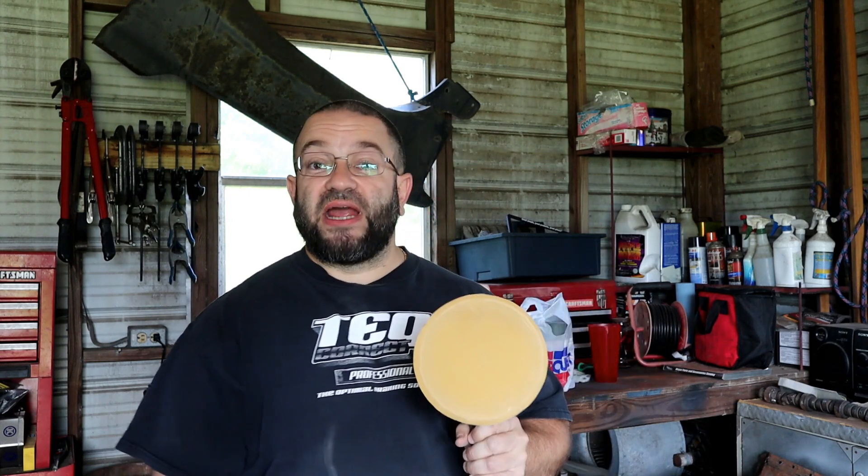So it's no longer rust or iron oxide. By doing that, it got a lot of the surface rust down, neutralized it, and left a little coating on there. Right now I'm taking a combination of regular sandpaper and the DA sander to finalize them so I can get them rinsed and ready for a little bit of etch primer. We're going to use etch primer, not epoxy primer, because I'd like to be able to sand it down in the future, and it doesn't need that kind of seal.